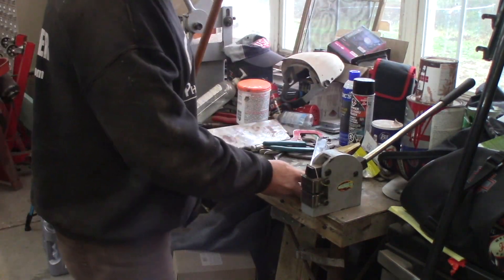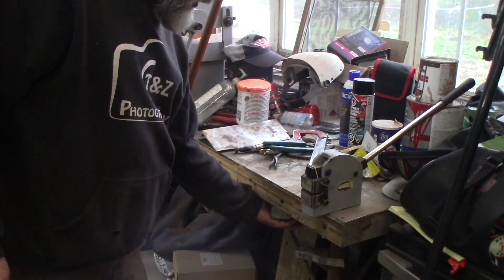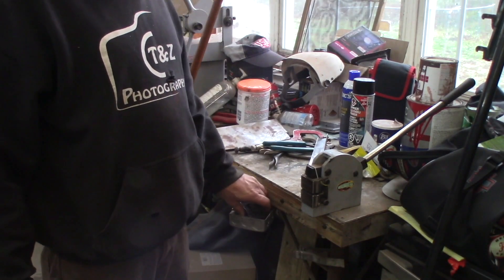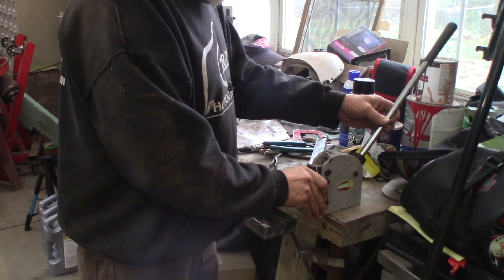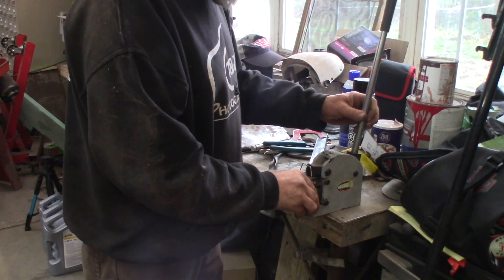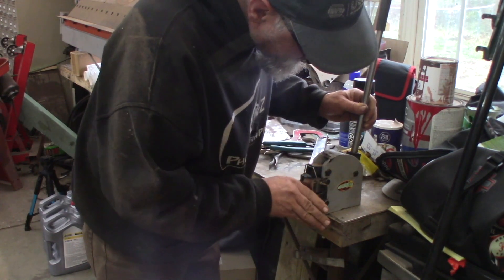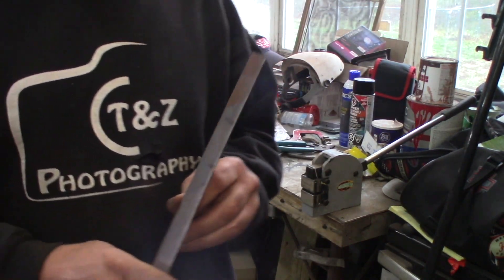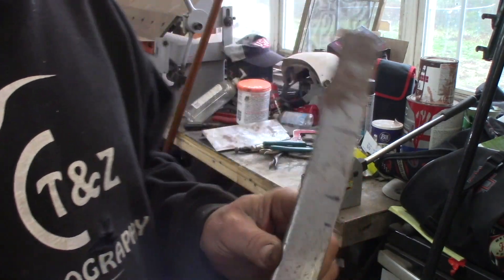So I've got to change the bend. This is the stretcher part — that would give me the bend out; I don't want that, I want the bend in. I made this nifty little thing — I just took an electric box and screwed it under there, put one screw, so I have a little swing-out drawer to put my other unit in. I kept worrying about losing it. So I'll loosen this up, pull this out, drop it in here, then put this one in. And this one's going to shrink it. I put a couple little dashes on here just so I know where I'm at — kind of a severe stretch between these two, and then that little one is just a little touch.